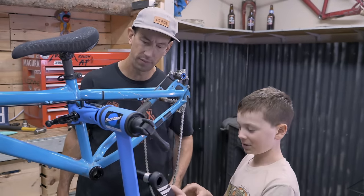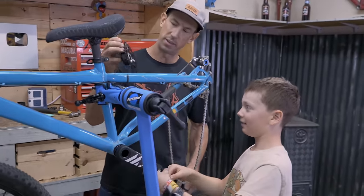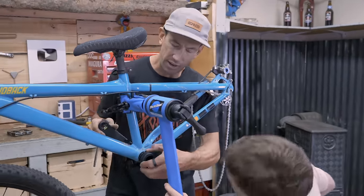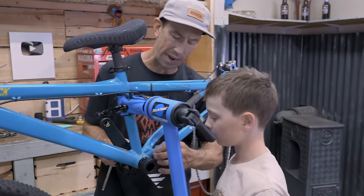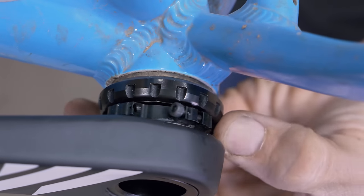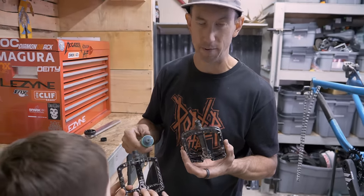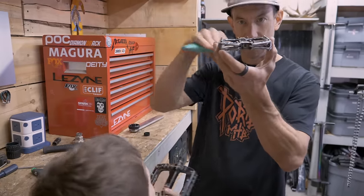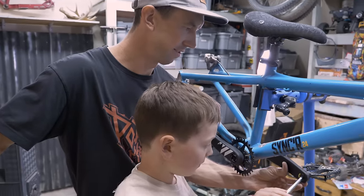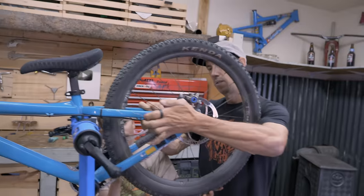Slide the cranks through with grease on the spindle. That's satisfying. Put the other side on, line up the cranks straight. There's a little lock ring that snugs it up so there's no gap and no clicking, plus a little set screw to tighten. Get the pedals back on with a bit of grease - these are the Deity T-Mac pedals, all-time favorite for all the bikes. They're strong with a nice concave so your foot sits down into the pedal. Then the narrow-wide chainring goes on in one direction only.